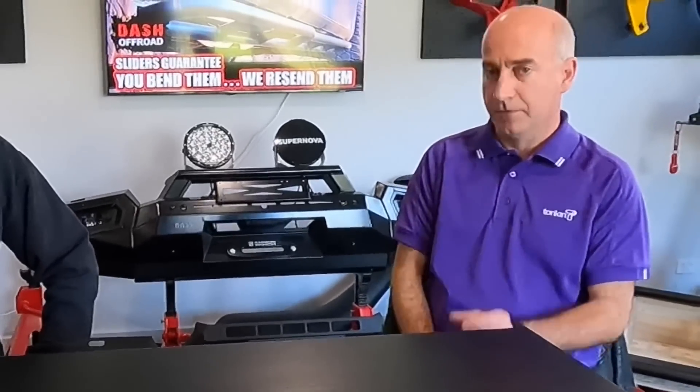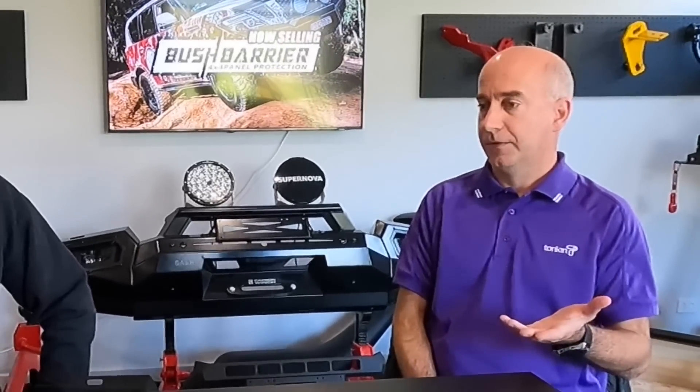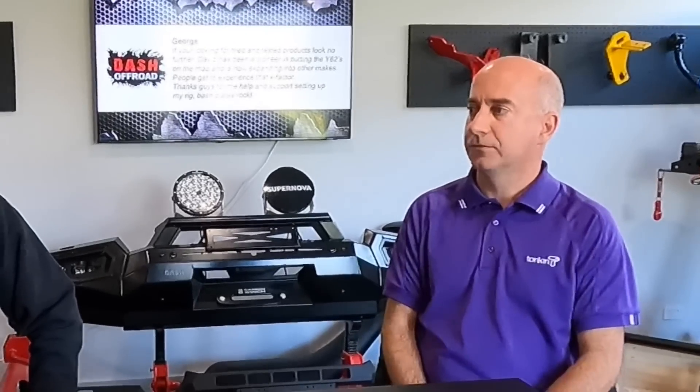It can be either. Obviously the manufacturer sets the GVM. If everyone looks on their car, there's a compliance plate on the Y62 — the white one on the passenger side B pillar. That's got a GVM, which is the certified maximum mass the vehicle can be, specified by the manufacturer. It has to allow the vehicle to carry a payload designated by the number of seating positions, an allowance for luggage, and hopefully a bit extra payload so you can tow things and accessorize the vehicle. In terms of that GVM, that is a federal process — the manufacturer provides that when they certify the vehicle as meeting the Australian design rules.